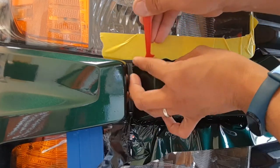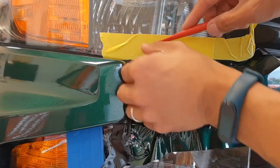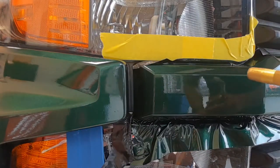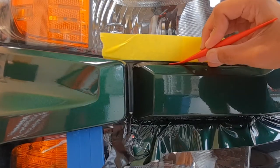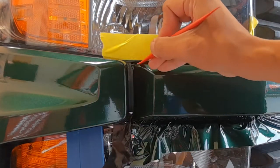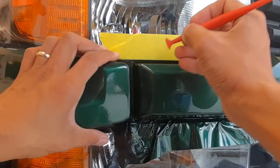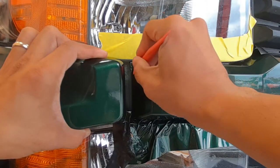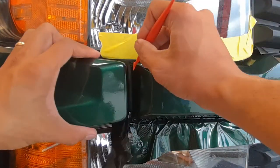The tape makes the vinyl release from the headlight so much easier because it's a lower surface energy than the super slick smooth headlight housing itself. I free up the vinyl off the tape and then use my micro squeegee to lay it down. I'm sweeping the vinyl as I push it — going in a direction to either the left or the right, not straight back. Laying it down with my micro squeegee, making sure everything is tucked in nicely. I'm spending a little bit of time on that corner so it looks like it's painted and has full coverage.